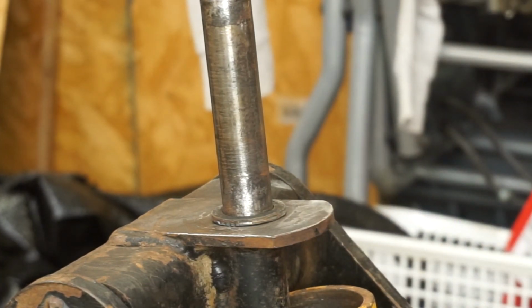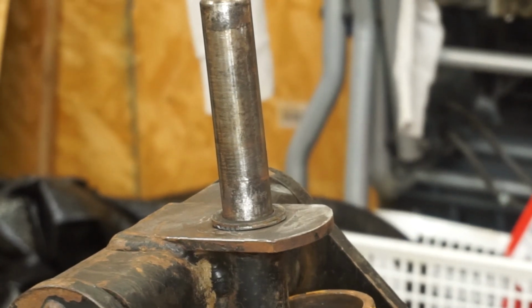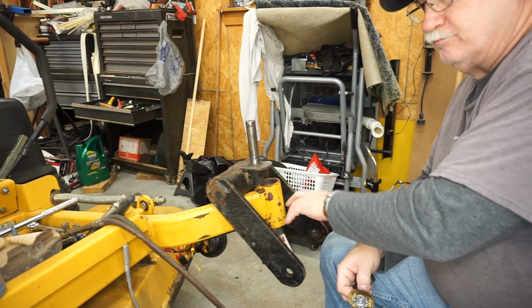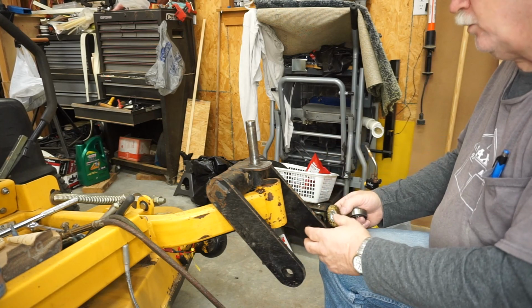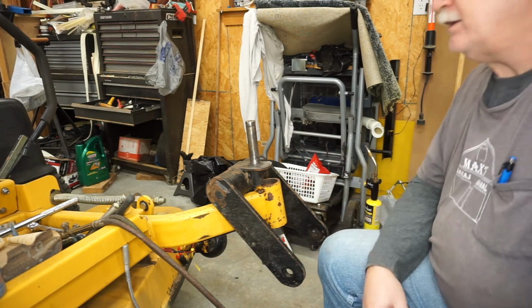We are going to put bearings in the wheels, or again, if the guy will come through for me and make me the aluminum wheels, or if I can get my hands on a lathe, then I'll take a set of go-kart aluminum wheels and I will make a new spindle to go through it. Let me back this out a little ways here. And what I'll do is I'll go ahead and make an axle for it that I can bolt the go-kart wheels to, make a flange on that axle bearing holder, or mount, so that then the wheel will mount to it centered in the caster.